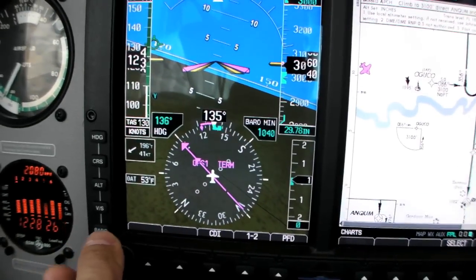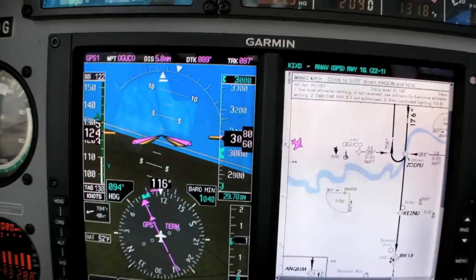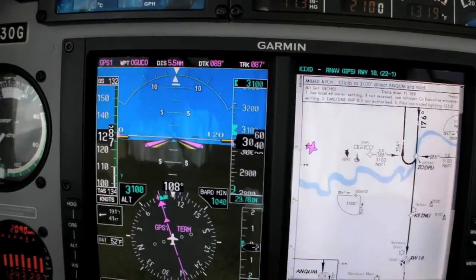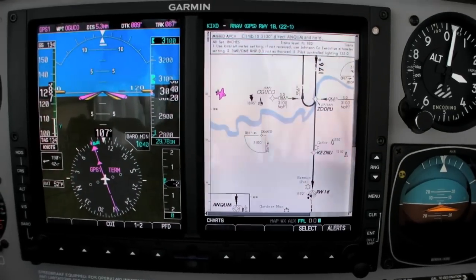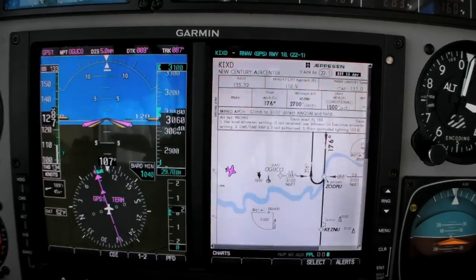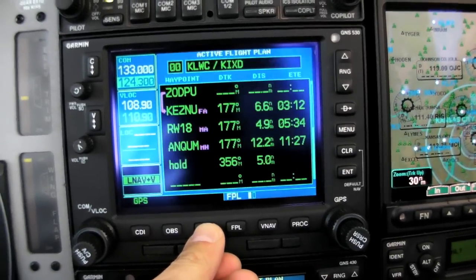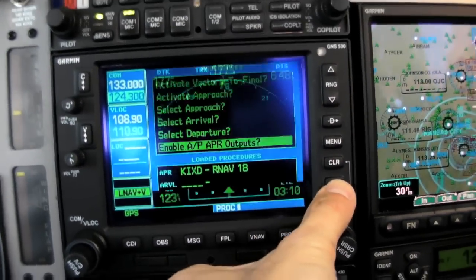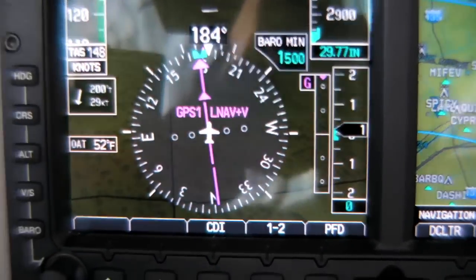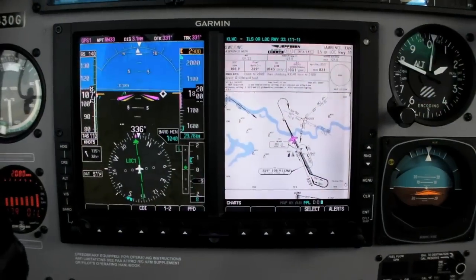The multiple small screens of the G600 cockpit is actually both a strength and a weakness. The PFD-MFD combination right in front of the pilot works beautifully in our opinion. The numbers are just large enough that they're easily readable, yet all the information — including the approach plate or weather — is right there for you to see. The disadvantage is that you have to have a wider scan to see information that comes up on the NAVCOMs that are fairly far off to your right. For example, with many autopilots the level of integration varies, and for our NAV approach we needed to follow a message queue to enable the right outputs so that the autopilot could capture and fly the glide slope. If you're thinking about a G600 or G500 system, make sure you know what level of integration is possible between that system and your own autopilot, as it varies quite a bit.